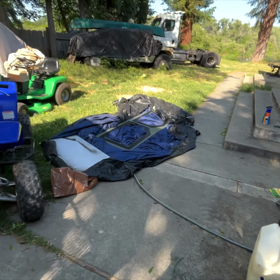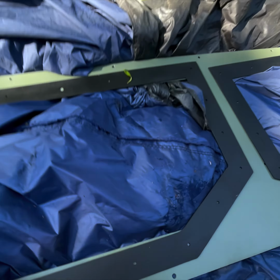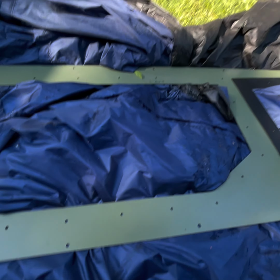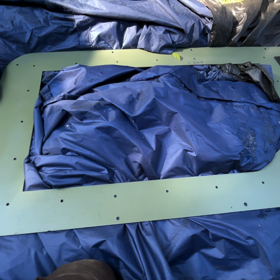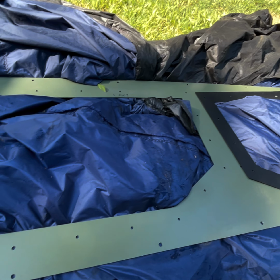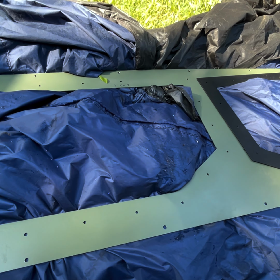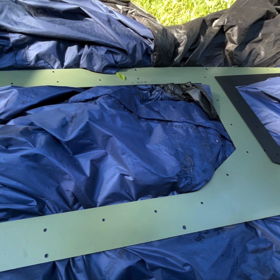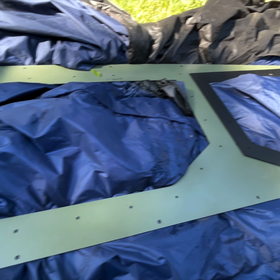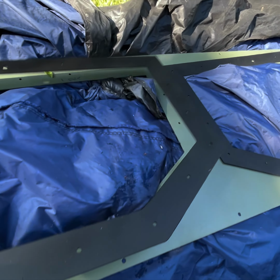So I wanted to explain how I made this essentially, just because I don't think I quite went through that. I started off with just a blank piece of aluminum, and I fitted it up to the windshield and figured out my perimeter holes. I just did riv nuts in the windshield. That wasn't too hard. Once I had that, I didn't have the actual dimensions of what the ballistic windows are, so I scaled it off some pictures, and I couldn't make them a whole lot bigger because I needed space between the flange and the bolting and everything. So it's in the ballpark, and I just kind of mirrored what I saw on the internet.